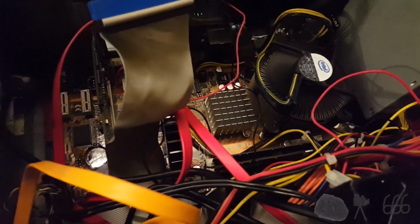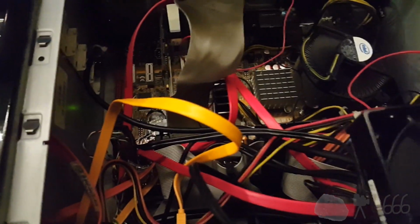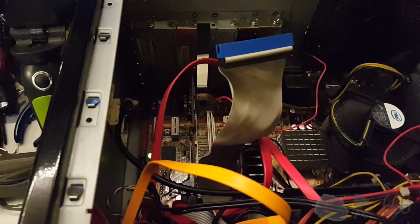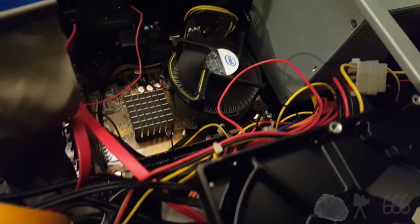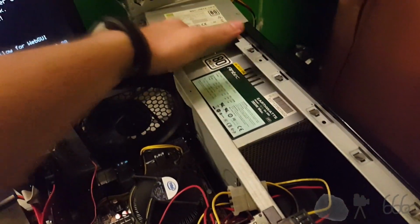It prevented me from entering the BIOS, made me think that the keyboard had some kind of an issue with it. So I had to go get out another keyboard, and when it still did it with that, I thought there was a problem with the motherboard, even though it worked fine when I brought it home. But nope, disabling the Marvell controller, because I kind of need the Rocket RAID, let me go ahead and get into the BIOS setup utility. So, oh well, that's just kind of the way that things are going to go, I guess. The system seems to be running fairly cool, though, which is nice.